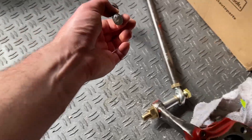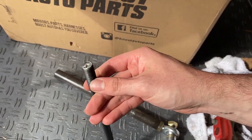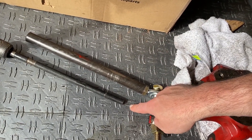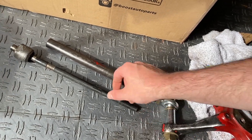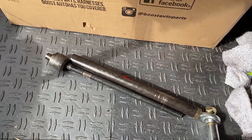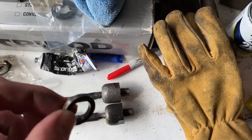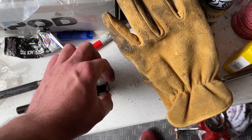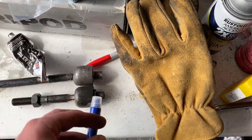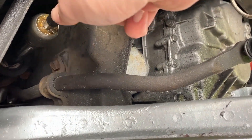It's another day. I'm doing a compare of the stock tie rod I just pulled from the car - this one has already been shortened from the old setup so it's not true stock length. I think we can cut about three quarters of an inch of threads off to align it right. Here's what the new inner tie rod looks like. I also had the Villain's rack spacer, an eighth inch rack spacer, so I'm going to slide that onto the new one and put a little dab of red Loctite on before screwing it into the rack.